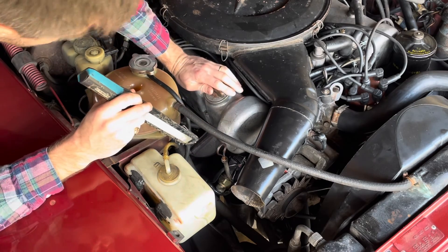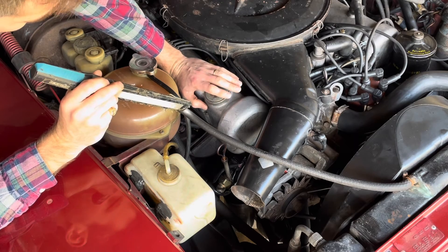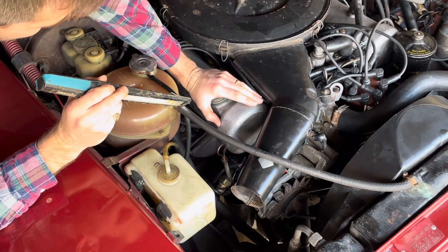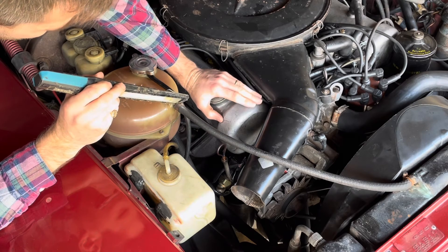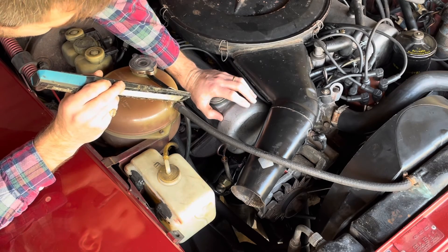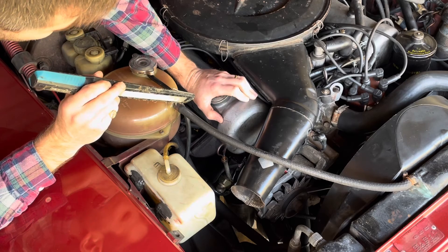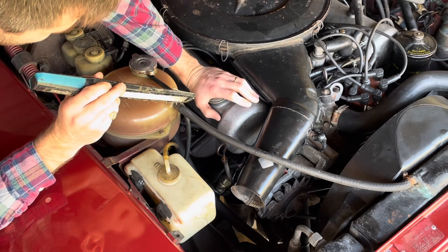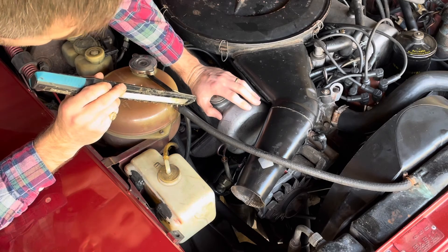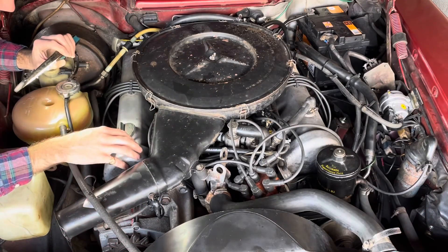If you're feeling brave, doing the chain yourself is a worthwhile exercise. One potential advantage the early cars have is that the upper chain guides are actually metal — provided they're in reasonable condition and the rubber running surfaces aren't breaking up, you can probably get away with not replacing them. Unlike the later plastic ones which must be replaced religiously, otherwise they disintegrate and get stuck in the timing gear causing the chain to skip. If you do pay for labor on the chain and upper guides, somewhere between £500 and £1,000 is probably realistic — not a job to skimp on.